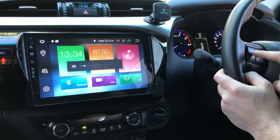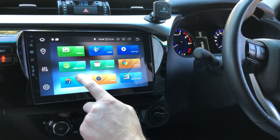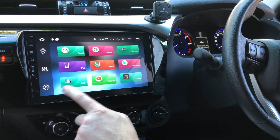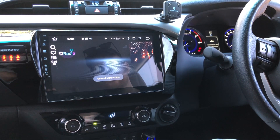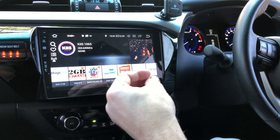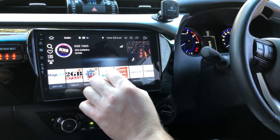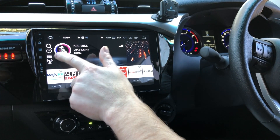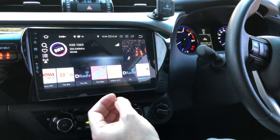Back on the home screen you can see volume up and volume down — very simple. For your DAB radio, you will have to search for radio stations the first time. Go to the DAB section and it will pick up your radio. GPS needs to be used out in the open — it's line-of-sight, just like your old stereo. You will have to press and search for the first time to pick up all the DAB+ radio stations.